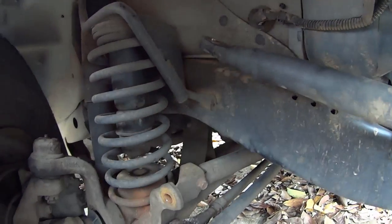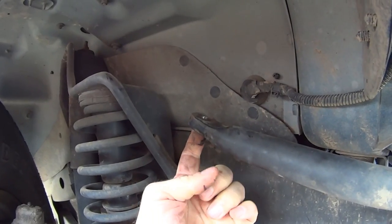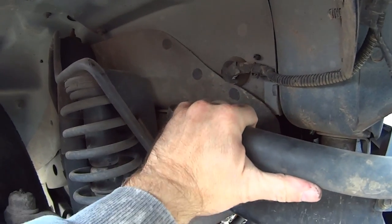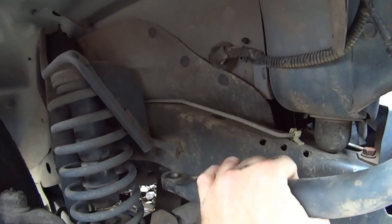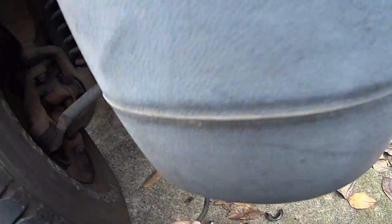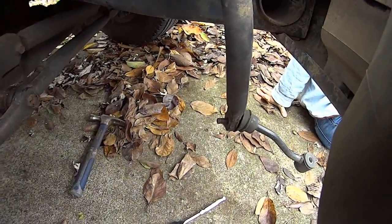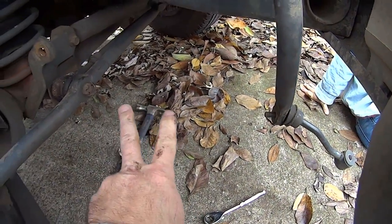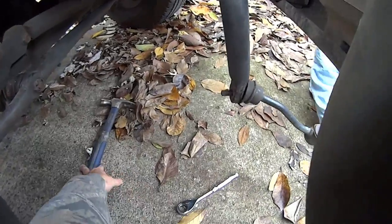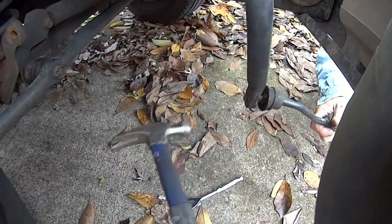Here's the trick: if you look close at these end links, this seat right here is tapered — it presses itself up inside the sway bar. So the best thing you can do for yourself is take them loose where it's broken, then take your sway bar and rotate it downward. See how it's tilting straight down? Your end link is still going to be stuck in here. Now you can use a pickle fork — the tool used for ball joints with a fork you drive in between to separate them — that's one option. The other option is get a BFH and beat it out. One good smack right there and it popped right out.